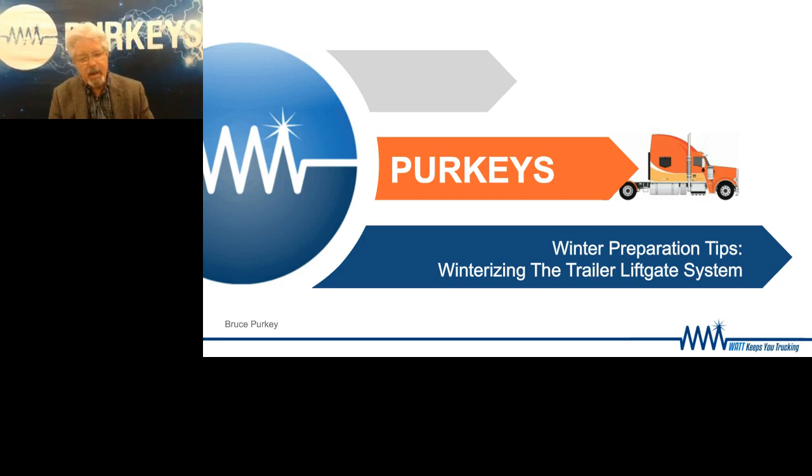The next part of the issue is the charging system is a long way from the battery. The alternator is at the front of the engine. We've got cables and all the connections between a tractor and trailer that go all the way back to the batteries. Those batteries are typically — if you put a piece of string on those cables and all the connections, you might have 50 feet of cable from the front to the back.